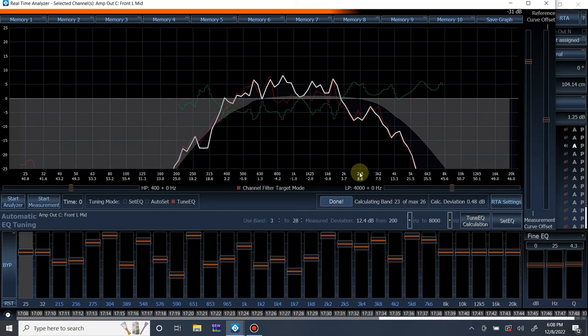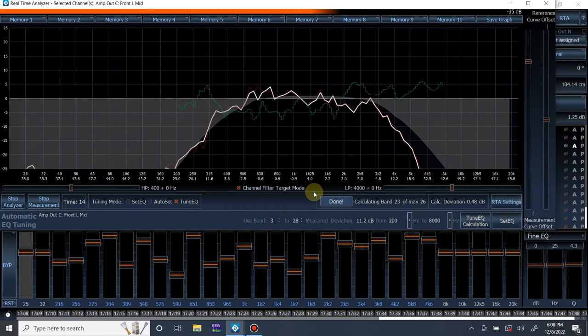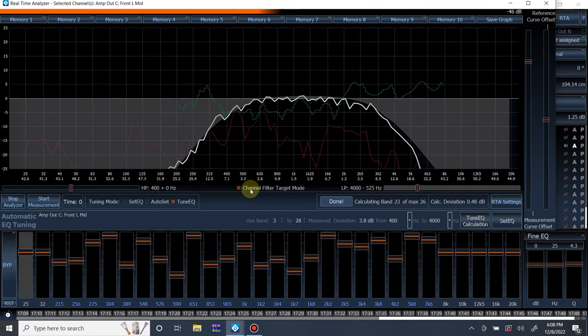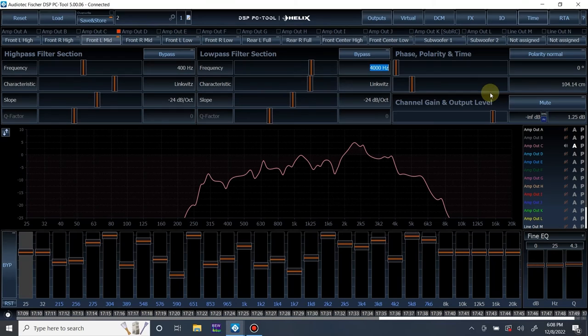Okay. So actually, this is exactly where I can use these features. Our crossover is set over here, and our measurement obviously measures below it. In order to get them to match up, I need to drop it minus 740 hertz or so. So to counteract it, I can bring it up 740 hertz. Or, octaves work a little differently, so I'm just going to bring it up 1,000 hertz. Remember, frequencies don't behave linearly, so technically you'd have to do it per octave. I'm just going to guess and bring it up to 5,000.